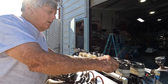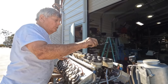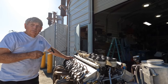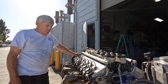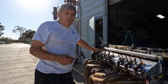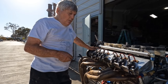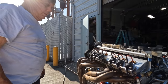Well, this is all above the cowl, right? Yeah. The box is above the cowl, so you cut a round hole in here and not rely on trying to pick up any boost. Yeah, just rely on atmospheric pressure, right, having it equalized. Because we ran it at El Mirage, Scotty ran it at 250 miles an hour. Yeah. With that scoop on. Then we ran it at Bonneville at 280 with that scoop on it. And these two cylinders were the ones that ran lean.